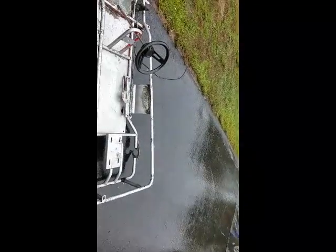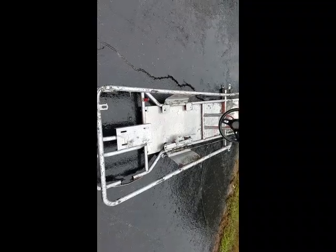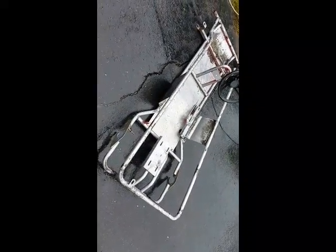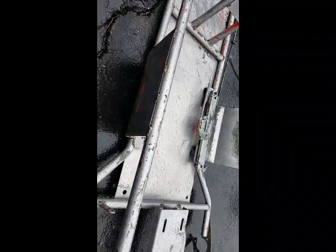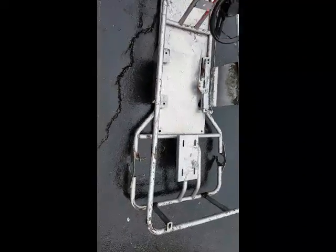So the chemical stripping on the go-kart process is complete now. Yeah, that is some clean metal. It almost looks like it's silver spray paint. After cleaning it up, I found a couple more cracks in the frame. There's one right here, and then there's another one over that way. So I'm going to hit it with a flap disc, finish up the rust spots, and fill in any spots that need to be filled in.